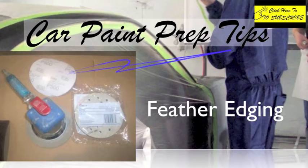However, where you ground the paint to put the body filler on, you have a really hard edge there. We need to smooth that out somehow. And also, when you were blocking, you may have blocked past your body filler area and scratched your paint surface with whatever you're sanding with. It could be 36, 80, 150, and you're going to have scratches in the paint that will need to be smoothed out as well. So these areas are going to have to be sanded out. And what we call this is feather edging.